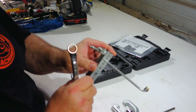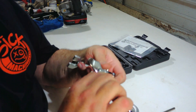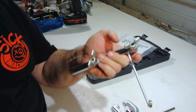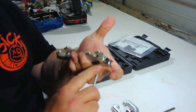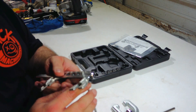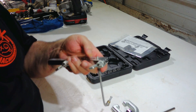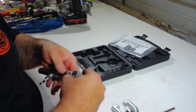A lot of guys on YouTube are doing hacks where they're replacing these wing nuts with bolts because they're taking a wrench to the wing nut and tightening as tight as they can get it. After a period of time the wing nuts are breaking. If you're having to use that much excessive force on a tool to get it to hold the tube properly so you can flare it, it's not the right tool for your application. Also, if you have the proper tool and you're using it on the proper materials, you should never have to put this in a vise to flare.